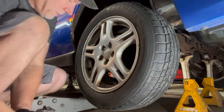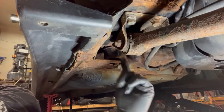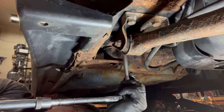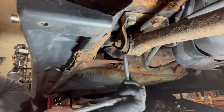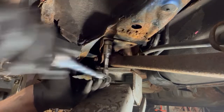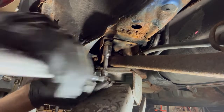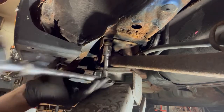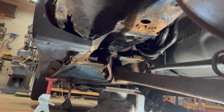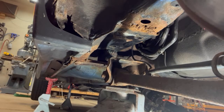Getting the tire out of the way, then getting a jack underneath the trailing arm. There are two bolts right here and another one in front that I'm going to remove. I'm doing these by hand because I want to drop this down a little bit and see how much tension's on it — I might want to put another jack underneath depending on the tension. I'll take the last bolt out and use the jack to drop all this down out of the way, so I don't have anything coming undone and falling on me — I'm not a big fan of that.